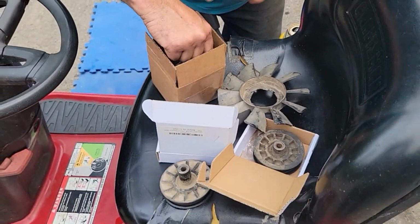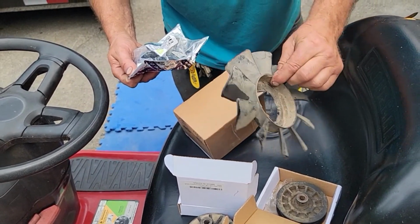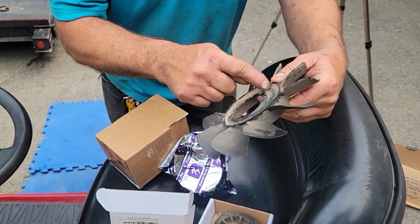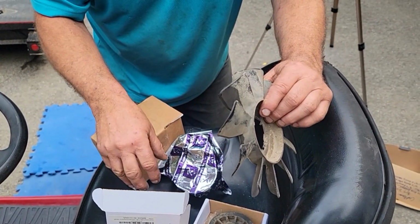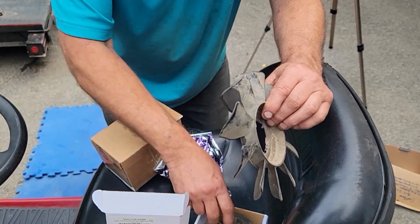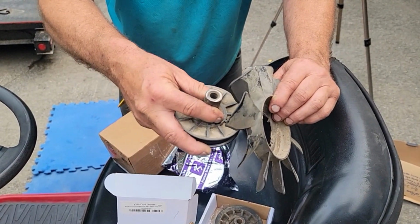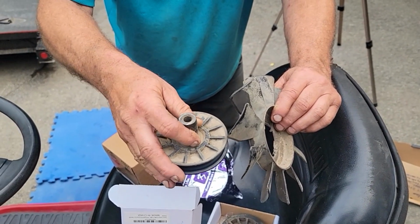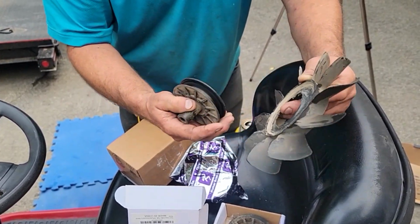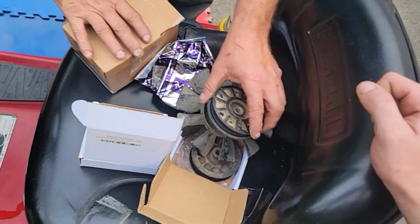Okay, so our new one came. Here's our old fan. Pretty nice, huh? What I think happened, guys, this is what I think. That looks like a belt rub. I think that the pulley started to seize up and jump the belt because the pulley was tilting, right, Dawson? Remember that was tilting? Yeah. This pulley was up there like that, and it was tilted, and I think forward would be lifting that belt up and getting stuck under the fan, and that's what chewed that fan off. Yep. And what burnt the fan up, and then it burnt that pulley. So started to grind. Yeah.